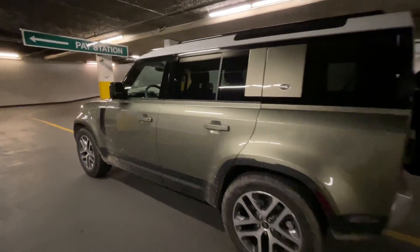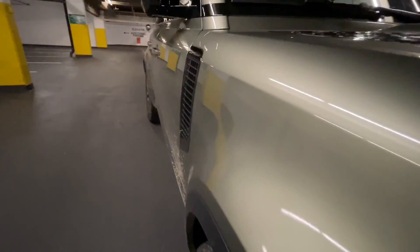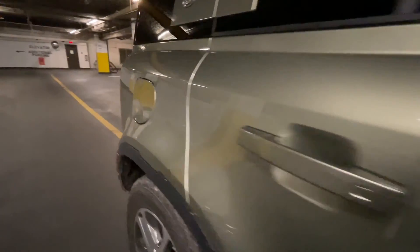Now in a used car, this is an absolutely critical step — this is how you tell whether or not the car had an accident and the paint was repaired or redone. By looking carefully around the car and reflecting off the bright light, in almost all cases you can tell if the car was repainted in some form or shape.